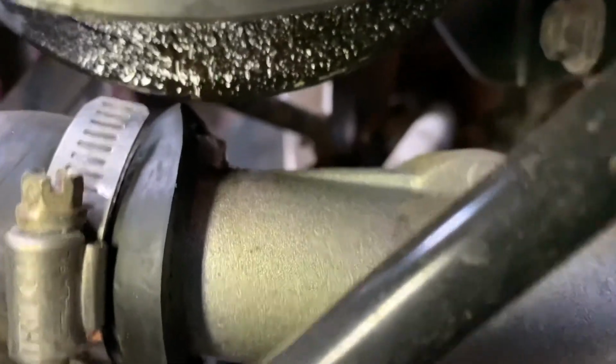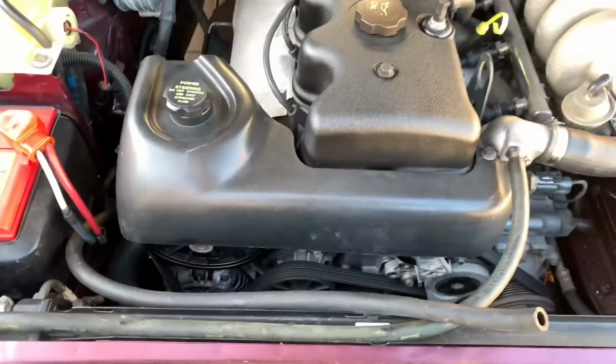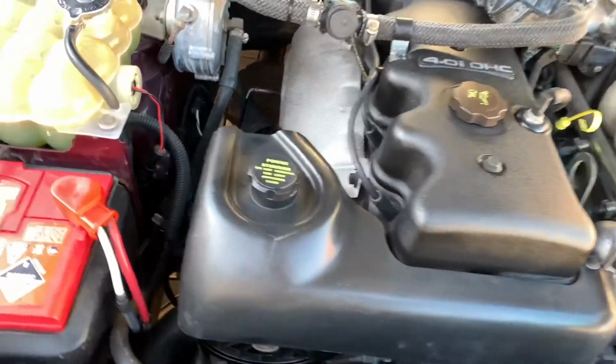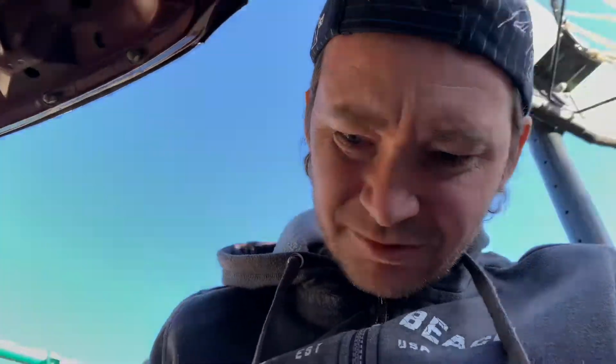So, new power steer pump. I'll have to get one of them now. But yeah, I did actually notice that when we picked it up, I thought it was the high pressure line, but it wasn't the high pressure line. It was the actual pump, the bottom of the casing. They are prone to crack and carry on, and then they leak all over the alternator, and then the alternator goes out, and one thing after another. So you're better off just fixing it right now.